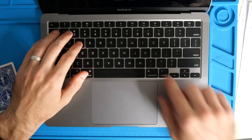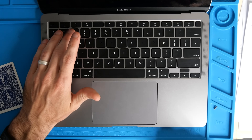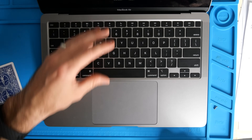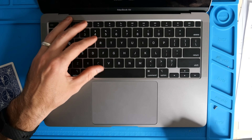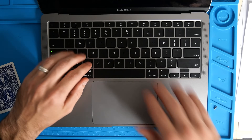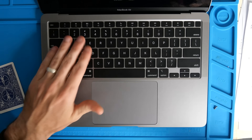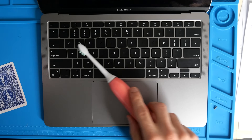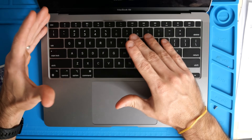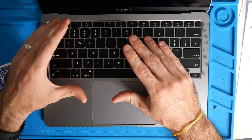The first thing you want to do is isolate what part of the keyboard is damaged. Is it crunching on just one key? Is one key not working? Is it a row or a couple of different keys? Usually it's wherever you spilled a sticky sugary drink — coffee, a smoothie, maybe some orange juice. Once you isolate those keys, you could try cleaning them with a toothbrush and isopropyl alcohol, but actually removing the keys and getting the gunk out of the switches is probably your best bet.